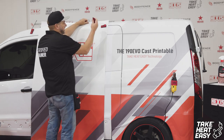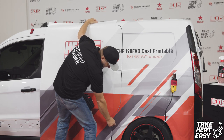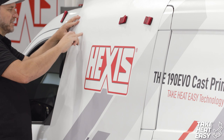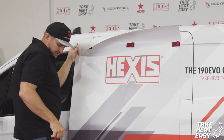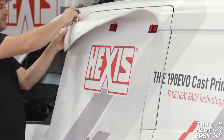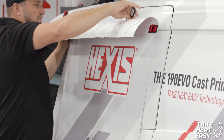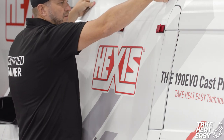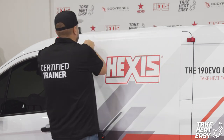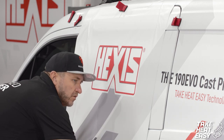I'll bring it over and find my registration using the shag magnets. By finding the registration, all I'm doing is bringing it until all the print lines up. You want to continually check it throughout the full length of the print. Set your magnets in place to check it one last time. I'll bring my magnets down to the edge of the metal, pull my material back with my Shag knife slitter, and pull it through with the Teflon — the black piece — in between the two layers, between the vinyl and the backing paper. Now I can pull away the top piece, set it in place, squeeze it down just enough so that it's holding in place. Now I can remove my magnets, grab the backing paper, and pull away the backing paper.